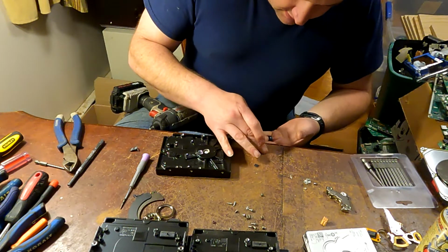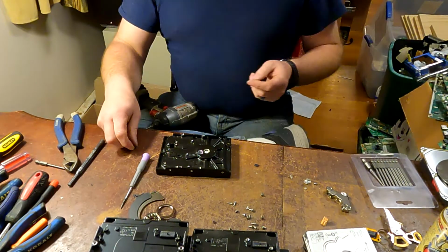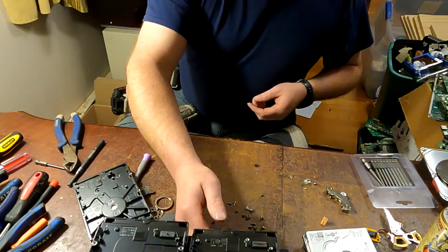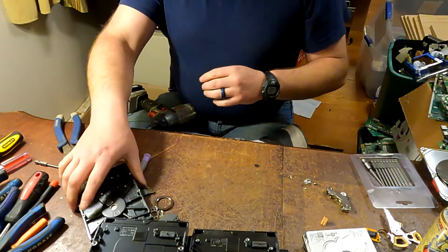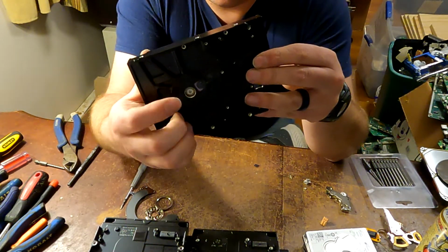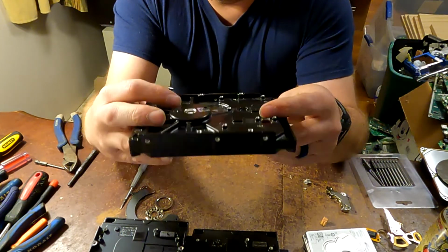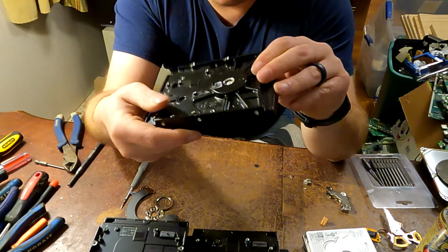And then you end up with the 3 ends here that are gold to add to your stash to recover gold from. The rest of that piece I'll toss into the shred. All the screws I toss into the shred. And you can either toss that in aluminum breakage or put a punch right there and pop that out. A lot of times this piece will come off without the windings. You can just stick a screwdriver in there and pry them right out. But basically that's it. That's going to be how to get the most money for these that you can, especially if you're going to recover the gold.